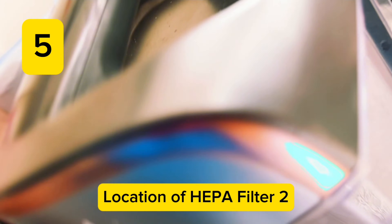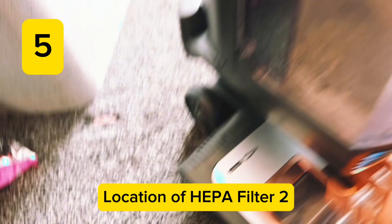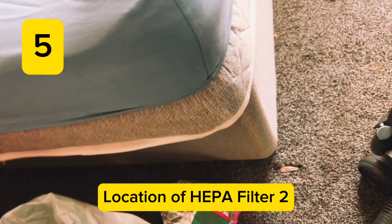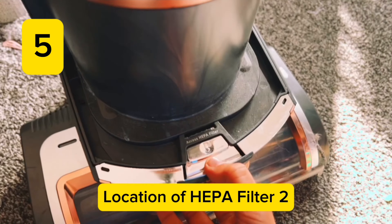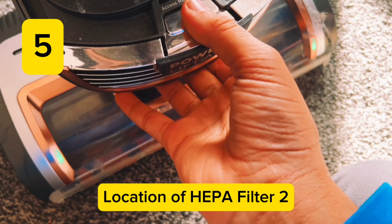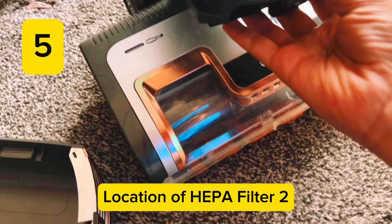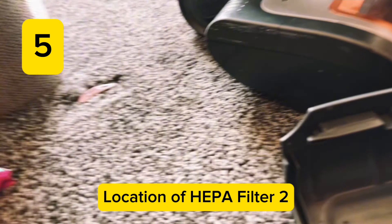As we saw, we knew there was another filter there, but there's another way to get the other filter out. What you do is take this off by pressing the dust cap button right here. There's an area underneath where it says 'access HEPA filter.' This doesn't get cleaned — it gets replaced if you notice your hoover is not acting right even after cleaning those filters. What you do is push down, and then you should have access to the filter underneath.